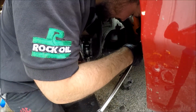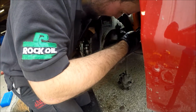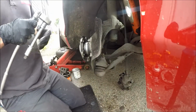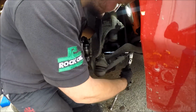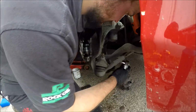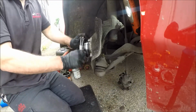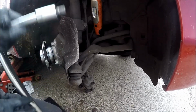What I was saying was, probably I have to look a torque specification up on these. Looking up torque specs on something like this, it's probably a better way of doing it. I've also put front and rear wiper blades on it, like brand new ones. Right, I've decided 80 Newton meters on these.